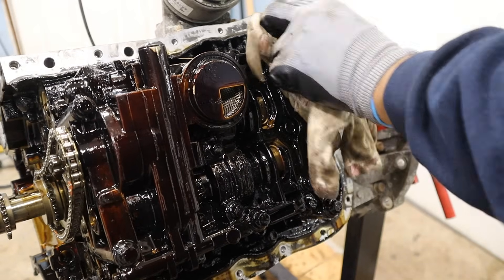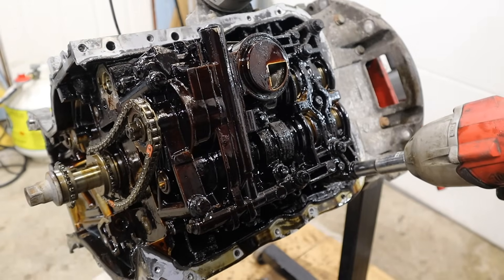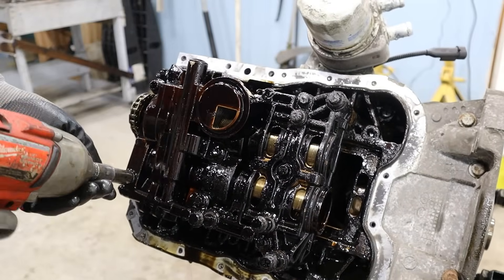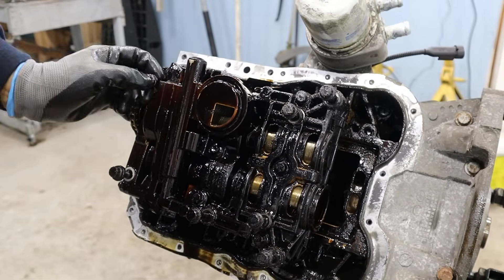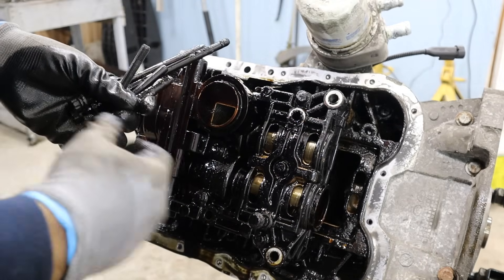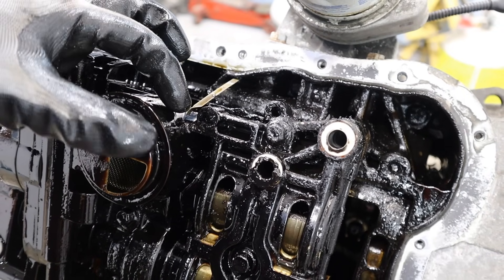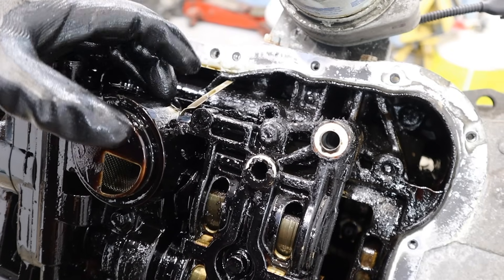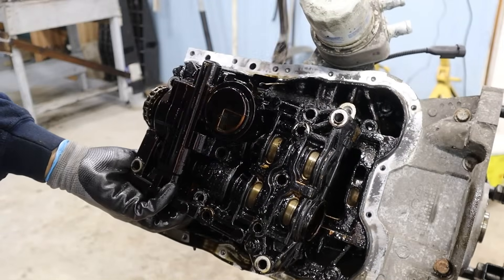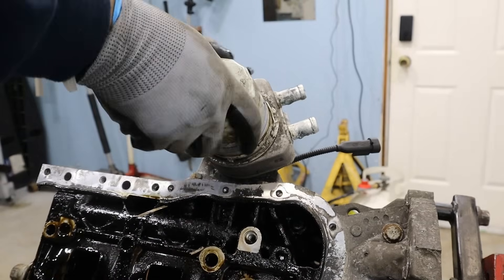Check out those grooves the chain wore into the tensioner slide. I'll get the tensioner slides off. I can't even tell what kind of bolts these are — there's so much carbon on them. I'll try a 12mm socket and break these free with a breaker bar — stinks in here when you crack them. You can see these front bolts went into the block while the small ones hold it to the lower oil pan. For anybody wondering, this is where the dipstick tip ends and this is the oil pickup — you can see how little margin you have before you're starving the engine of oil when the dipstick reads empty. There's your balance shaft and oil pump assembly.